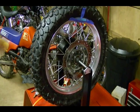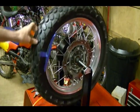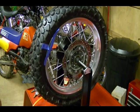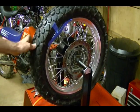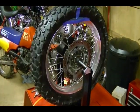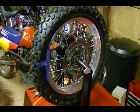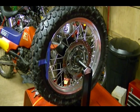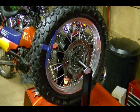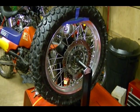With the weights on there, rotate the tire 90 degrees and see if the heavier part still outweighs the weight you just added — which it does — so I need to add seven weights. Now I've got seven weights on there. Rotate the tire 90 degrees and see if the heavy part still outweighs it, which it does slightly. So I need to add another weight; I'll go for eight weights.